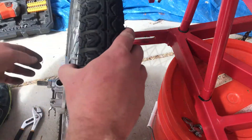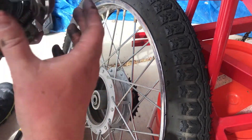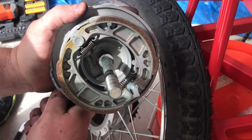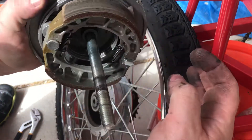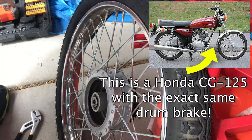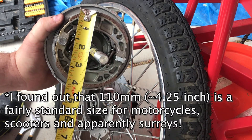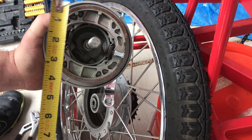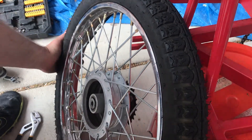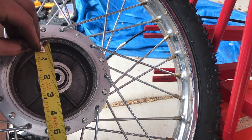In taking the bolt off I managed to release the drum brake — check this out. Here's the whole axle. As this arm turns, it applies pressure outwards, which pushes these pads outwards. The code on here says CG125. The brake pad measures four and a quarter inches, and including the pad it measures just about four and a quarter, so when it extends it goes even further. On the inside of this drum — hence the name drum brake — it measures right about four and a quarter inches. They rest really snugly with each other.